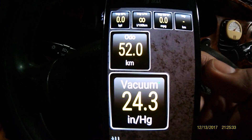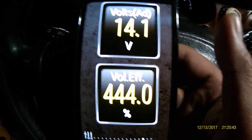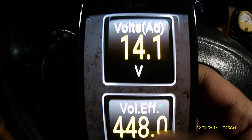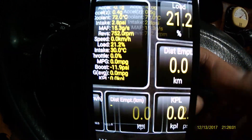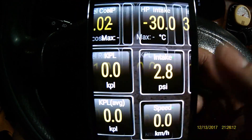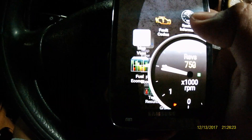Once you're able to get the correct protocol for your car, stick to it and make sure you save it. That way, once you unplug your ELM adapter and plug it back again, it will remain the same and won't change anything on the ECU or the computer box. This application is for diagnostics and checking the stats of the sensors of your car. It doesn't create any modification on the ECU — some people think it acts like a chip tuning device but it's not; it's only a diagnostic tool that can scan your sensors and check error codes.